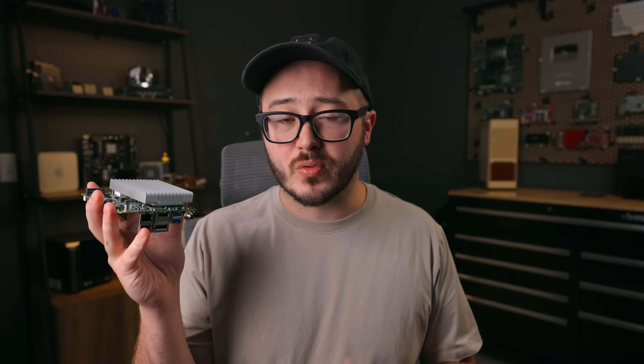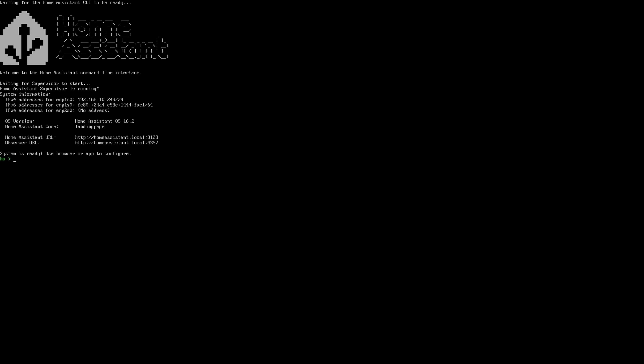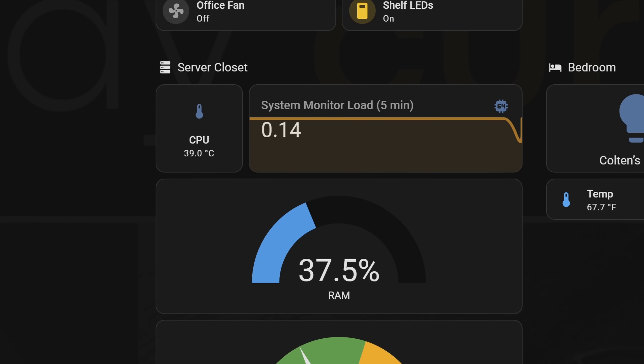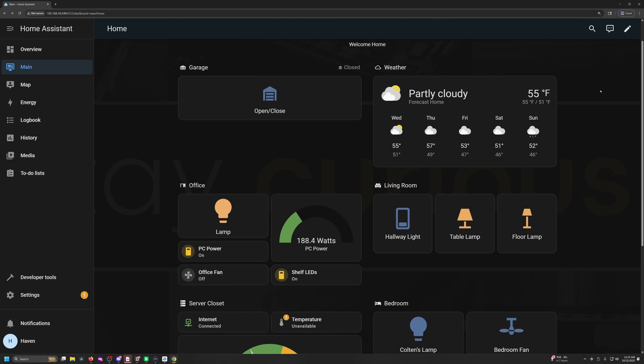This could still be capable of running some lightweight tasks, and I had a feeling the 2GB of RAM was going to be the bigger issue. To test that out, I started by installing Home Assistant OS, which actually worked just fine. I wasn't concerned about the CPU, but I was a little concerned about how 2GB of RAM would work out. As it turns out, we were only really using about a third of our memory. I looked at my actual Home Assistant instance running in a container, and that was only using about 500 megabytes — so for a pretty standard Home Assistant setup, this would work fine.